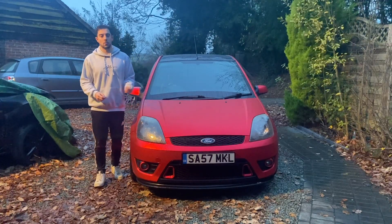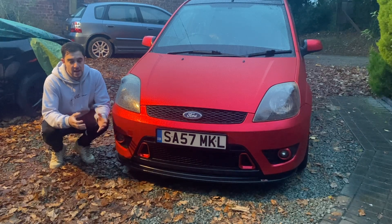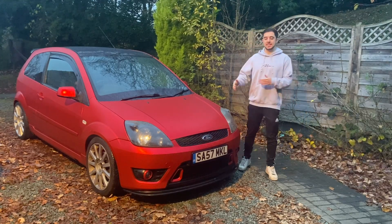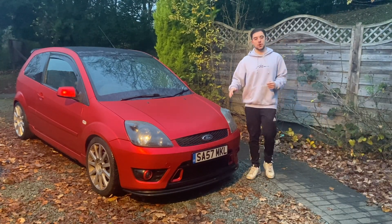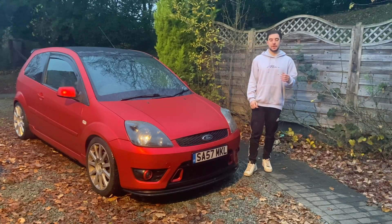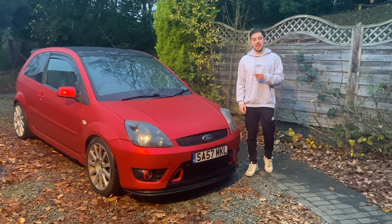On the second run I went for a blast up the dual carriageway and when slowing down for roundabouts and coming up behind traffic the engine temperatures rose really quickly and took quite a while to come down again. So I definitely think heat soak is still going to be an issue. In the future I want to look at actually protecting that cone filter from engine bay temperatures with some sort of enclosure or shield to keep the intake air cooler. I've been doing some reading and watched a really interesting video by Engineering Explained on the effects of keeping intake temperatures colder - I'll leave a link to that in the description.